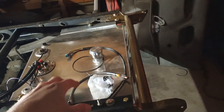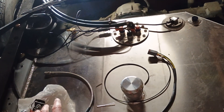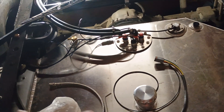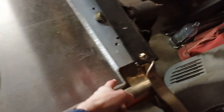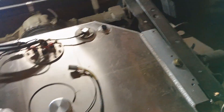Back here we have a Boyd's rear mount gas tank. If you want to do a Boyd's tank, I am all for it — this thing is awesome. However, if you're going to drive your car really hard, I would recommend a fuel safe setup because they're safer and stronger. If you bolt a tank like this to your frame, use one bolt on this side with a thick rubber washer, and then on this side use two. These frames are not very rigid, so the frame's going to tweak this way and that way, and if it does it for too long it'll crack your tank and make it leak. This allows the tank to pivot forwards on the one rubber washer there — safe setup.